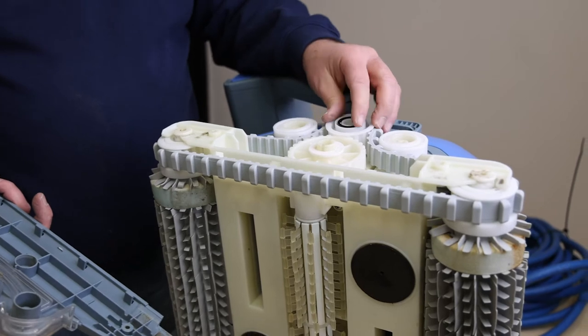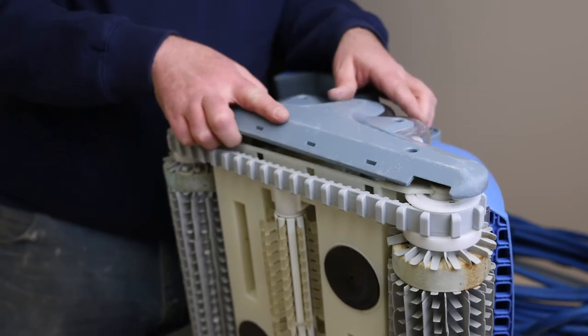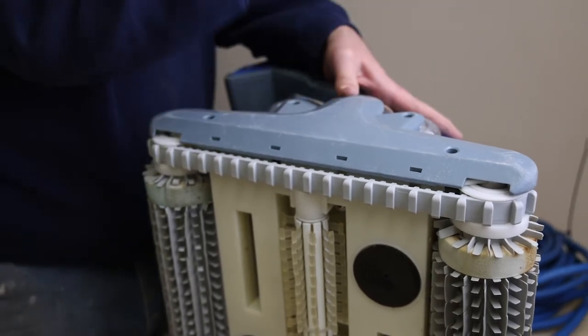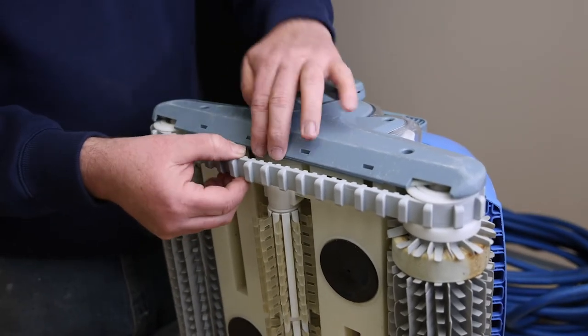This is meant to be very tight, especially if the tracks are new. Lastly, line up the side plate with the holes inside of each guide wheel and strike it firmly to lock it into place. Do this first on the bottom and then secondly up by the guide wheels. Make sure that everything sits down nicely and is in place. Your new track should be noticeably tighter — tight to the point where fitting your fingers on the inside space is difficult.